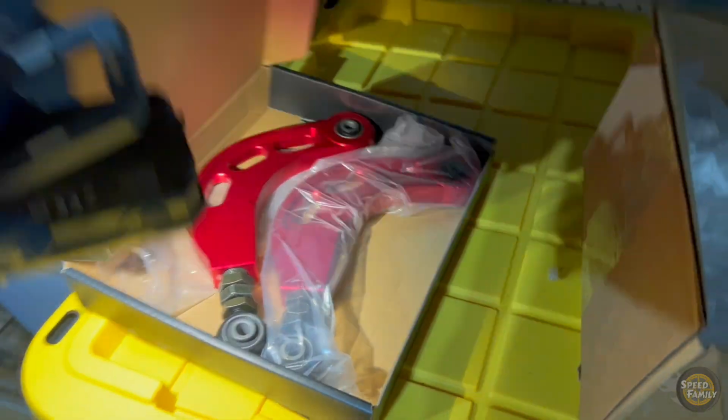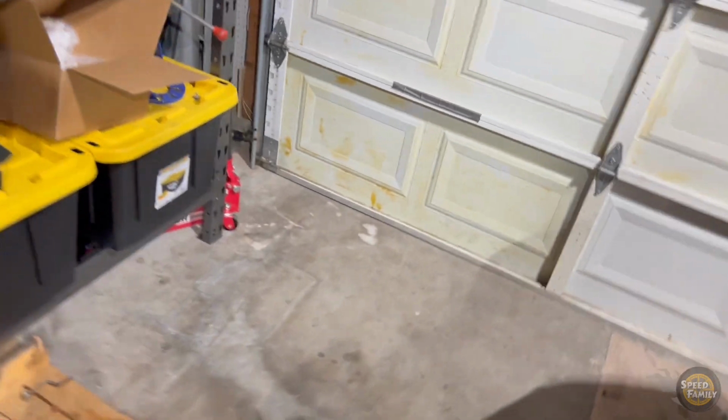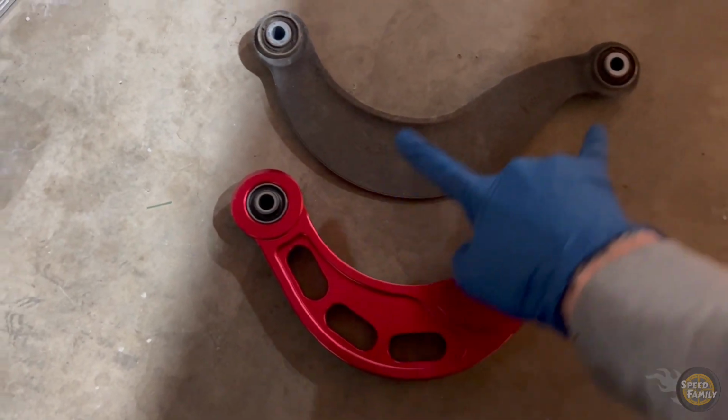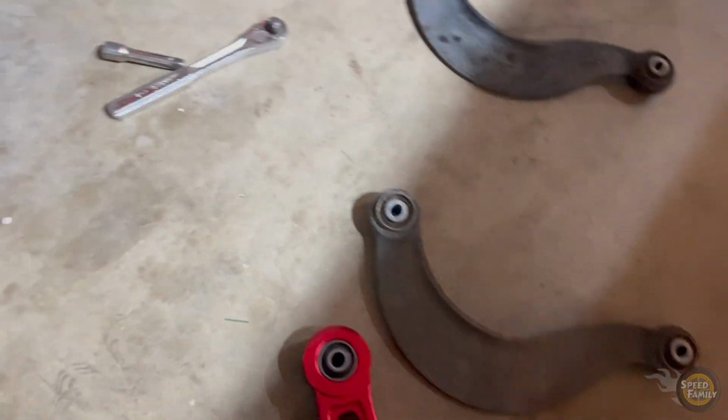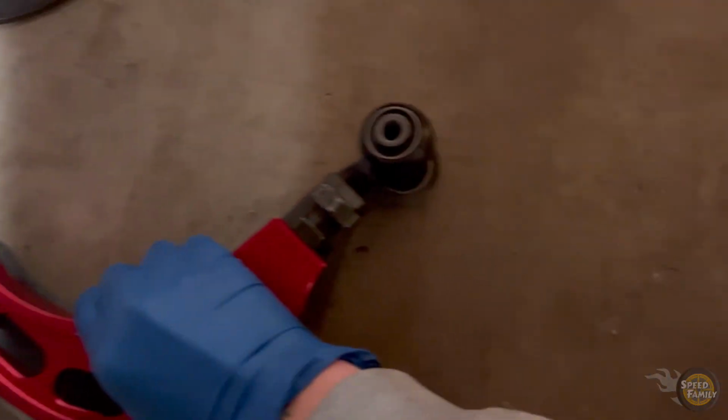camber arms, baby. All right, y'all. So what we're gonna have to go ahead and do is we're gonna have to get one of these. I'm gonna go get one of our camber arms over here. And we're gonna have to make sure that these 2 points are the same length as these. Pretty much got them matched up here. Holes align on each side.